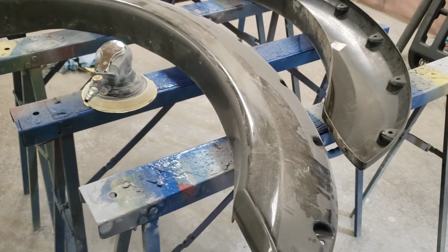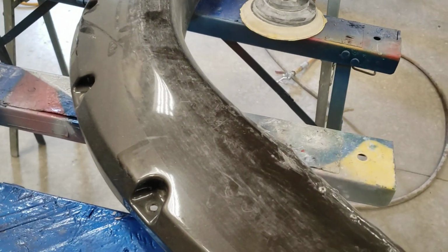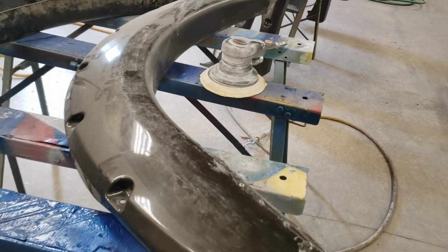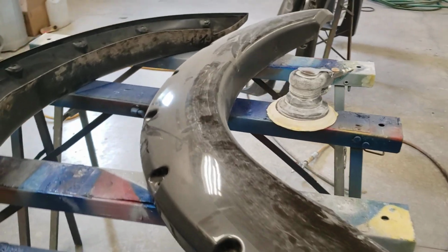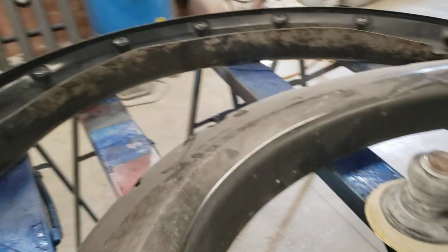I think he's got a chrome bumper on the truck now, so we're going to scuff that super duper rough with a roll lock, put 3 layers of epoxy primer on the bumper, and this way we can paint over it and it'll stay. I know a lot of guys at home, if you're going to do the spray bomb, they make paints that they claim, I think, what is that, VHT or whatever that good stuff is anyway, for doing rims and stuff.